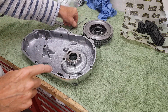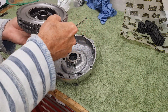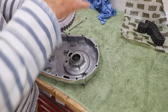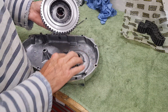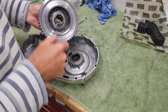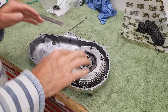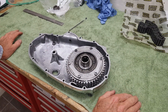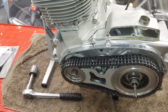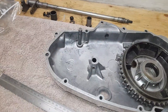The first thing I need to do is work out where this chain wheel is in relation to the primary chain case. I'm going to loosely fit the chain wheel shock absorber assembly into the back of the outer primary chain case — we've got the bearing face there and the thrust washer in place — so that I now know where the chain wheel is going to sit. I've already videoed how to do this, but thinking back I don't think I explained it very clearly, so I'm going to re-explain it using the old sprockets.